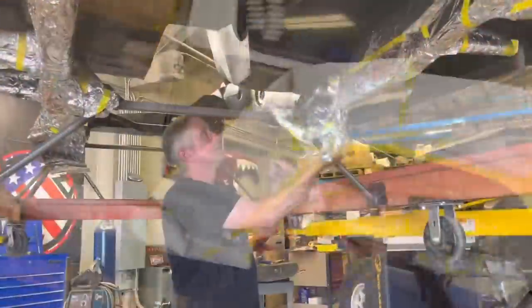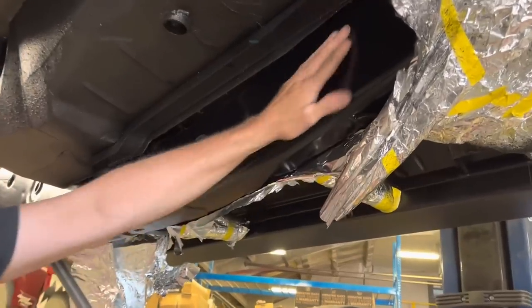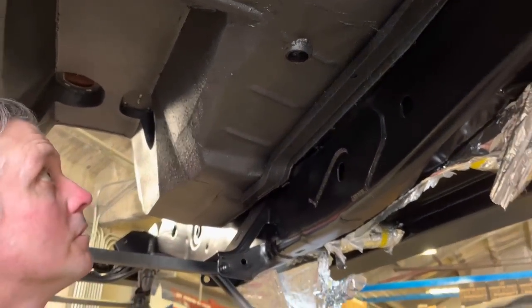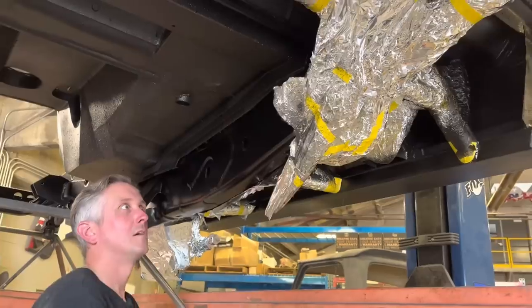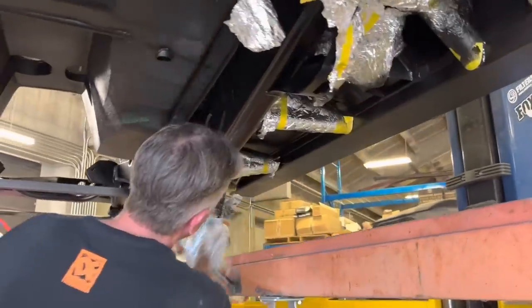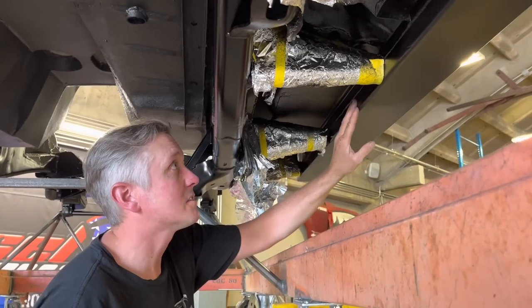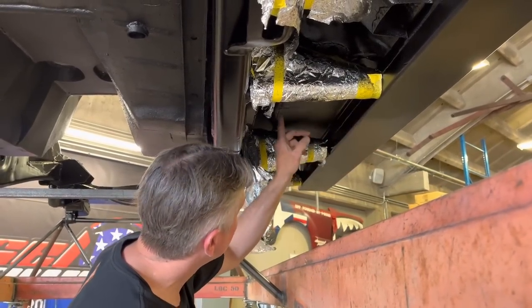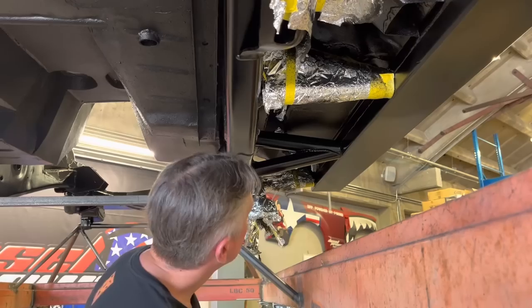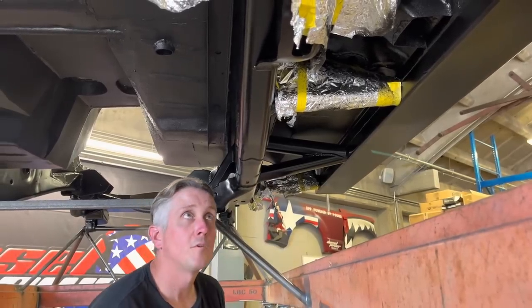I think it should have worked — this is the payoff after many hours. Still nice and shiny on the chassis, and over here has the texture to it. I think that was a win! This is one of my favorite parts — how it all came together. We've got a rock slider that's welded to a section of stock sheet metal, welded to a section of flat sheet metal, and the undercoating and bed liner just sort of ties all that stuff together. There you go — rock crawling. Smash it in.